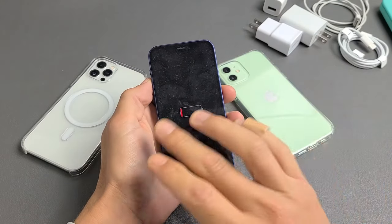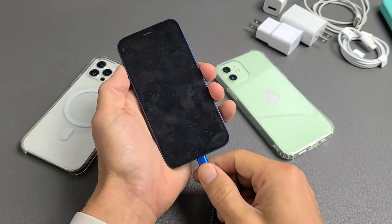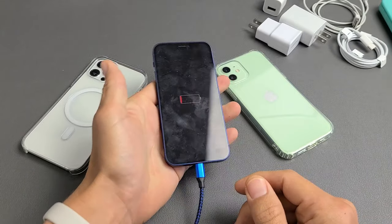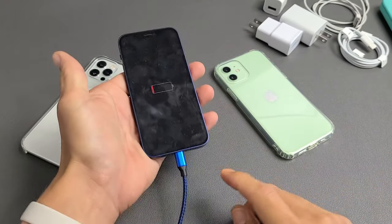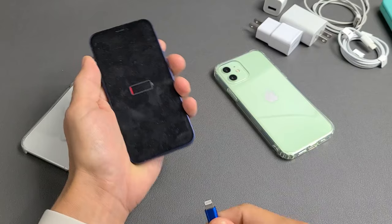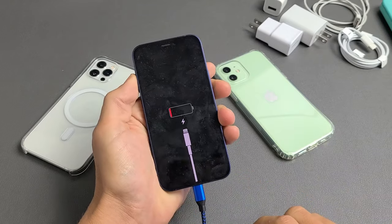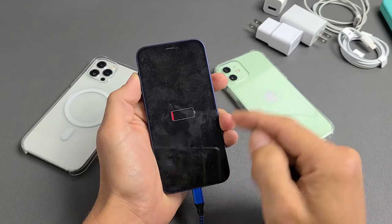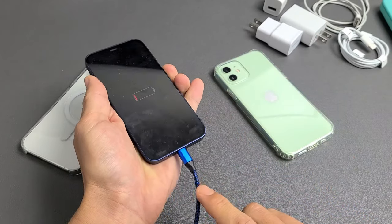All of these iPhone 12s are actually fixed, but we're going to pretend we're stuck. When you have the power plug plugged in, once it reaches about 3%, all the iPhone 12s should automatically turn on. So if you've had it in for 10 minutes, it should turn on. If not, then you have an issue. You can see when I pull it out, you get this cable icon saying it's not charging. When I pop it back in and press the power button — there we go. But for you guys, the phone's just not turning on when the cable's in.